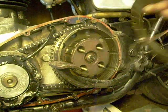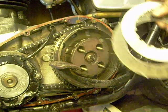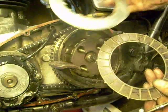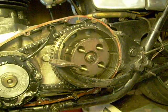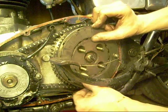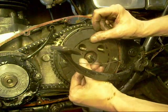If you have a spare set of plates — if you're doing any work on clutches — get a friction plate and a plain plate and bolt them together like so. Alright, this is how I lock the centre up and get them lined up.